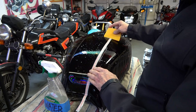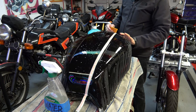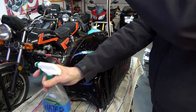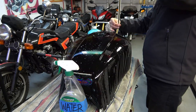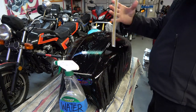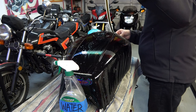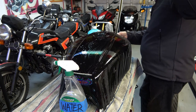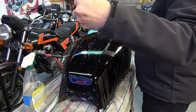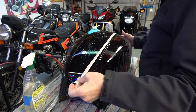The nice thing about soap and water is it evaporates really easily. Once it's on there, you get an auto body squeegee — like the yellow one I have here. As you can see, I had to peel the stripe back up and reposition it, and again that's easy to do if it's very wet and soapy. It takes a while to dry before you squeegee it, so once you've squeegeed the water out it's a bit more difficult to peel back up. Anyway, get it positioned properly.